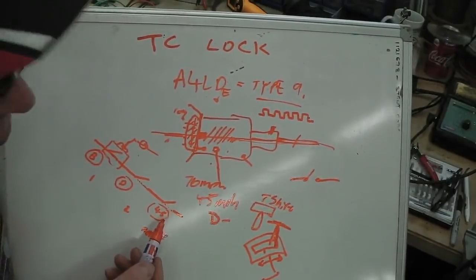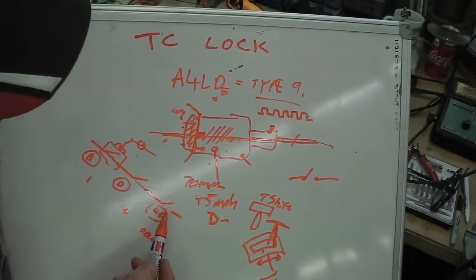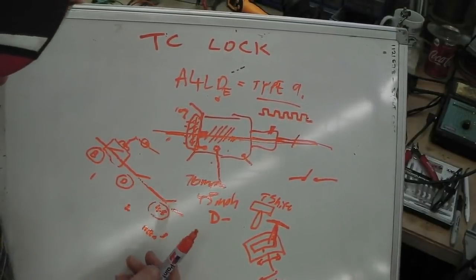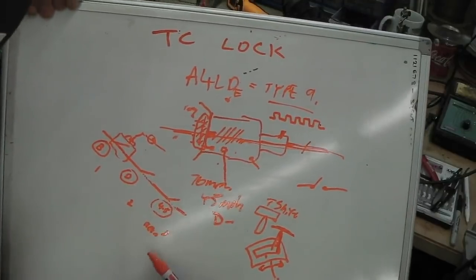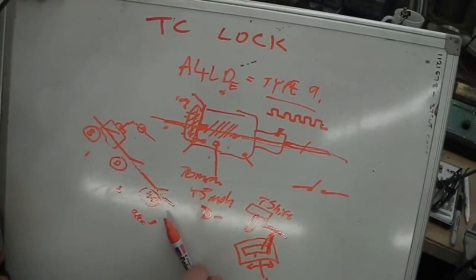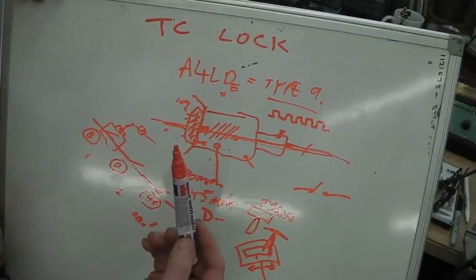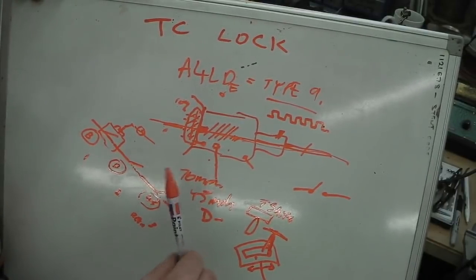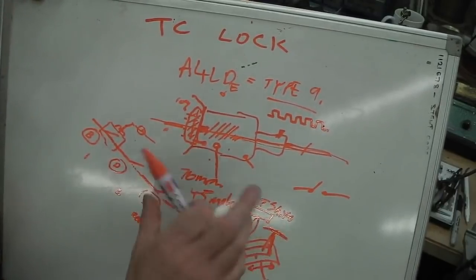So as soon as you drop below 45, it's got to cut out and drop that lockout. But what you don't want is when you're at 44.9 mile an hour dropping out and then going to 45 and dropping in, because that's called hysteresis. That's the switching point. It'll cause what's called chatter on the relay. So the relay will be going click, click, click, click, when you're around that sensitive 44.9 to 45 mile an hour area. So you're building some hysteresis, which is the zone of switching.